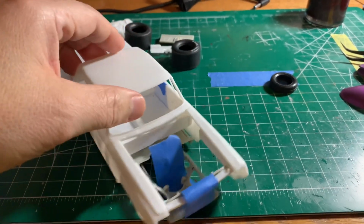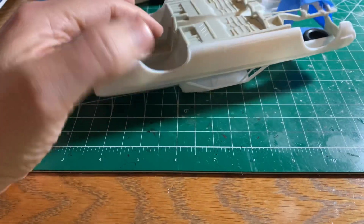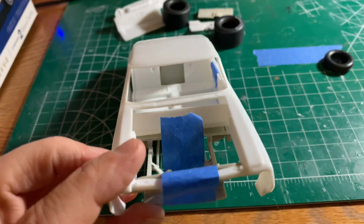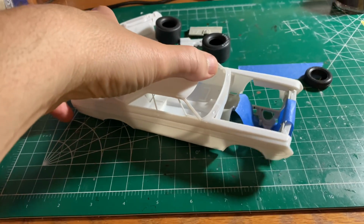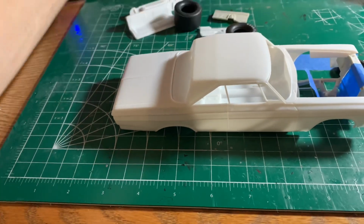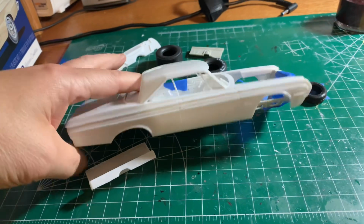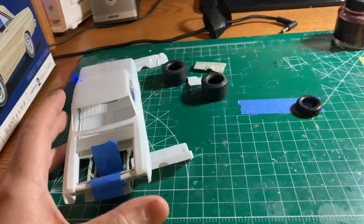The other thing to talk about is one of the mods I did have to make. This is a problem because it goes way up and it interferes with the interior tub right in here. So I had to cut the square out of the back, right there, you can see, to accommodate that extra space. So I can get it to shift forward and have the tray back here fit flush where it's supposed to fit. To be honest with you, once you cover it up with your back seat, you'll never see it. There's no sign of it down here, and there won't be a sign of it in there. However, my OCD is kicking in, and I'll know it's there, and I'm feeling like I should finish it off with a card or something.